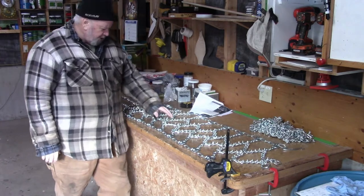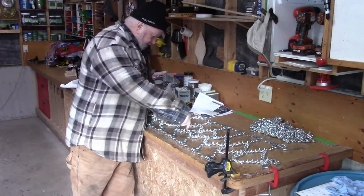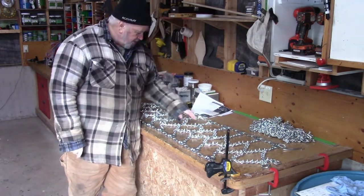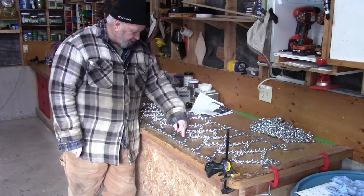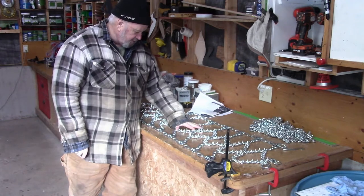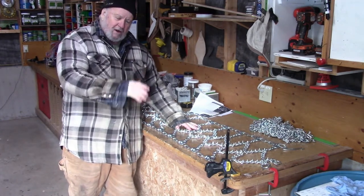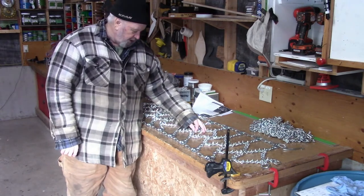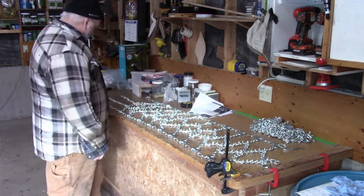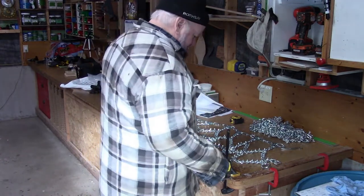One of the things I liked about these chains was not only the studs, but it has what it calls a diamond pattern. So instead of just straight cross links across the tire, you get a few links that come in and then the cross pattern. The idea of this is the pattern will stay up on the bar treads of the tire, not fall between them, and it'll give good traction. And then those ice corks will dig in like you won't believe. So it looks like these are going to be the proper chain — that's a good thing.